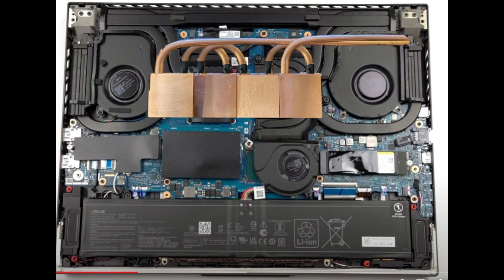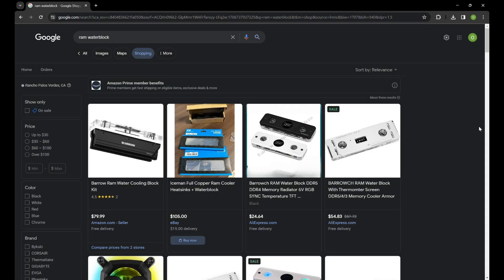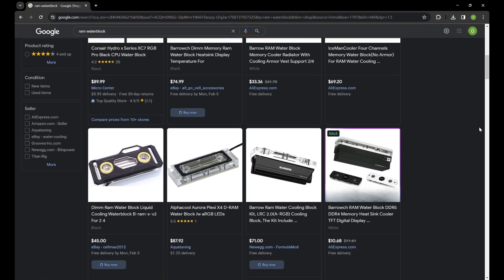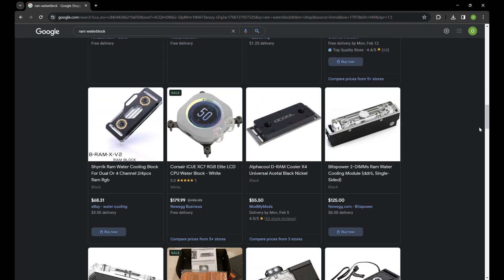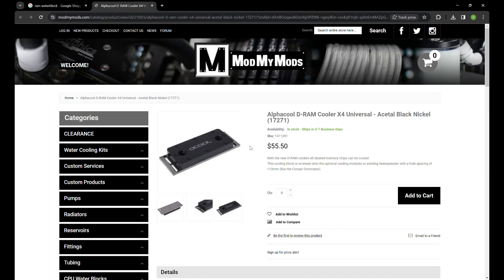The more I looked at this, as I was trying to solder everything together, it looked horrible, and on top of that, each of the solder joints is just sitting there presenting a point of failure if there wasn't good penetration or it gets bumped the wrong way. Continuing down that train of thought, I started thinking about RAM water blocks that kept popping up on water cooling subs and elsewhere, and realized that most RAM water blocks are actually the same dimensions as the one I was trying to make, only they're made by an actual manufacturer with O-rings and bolted together so they're serviceable.